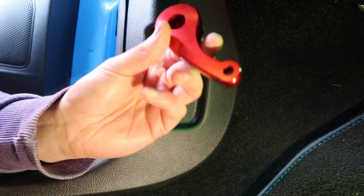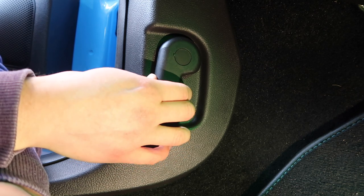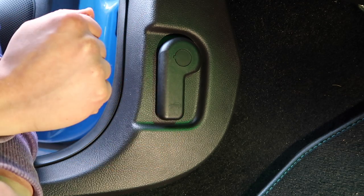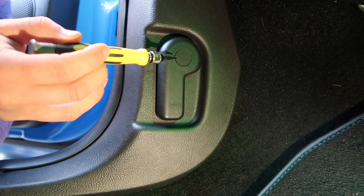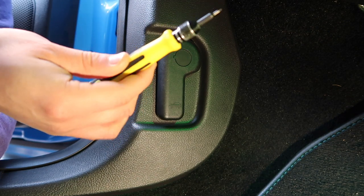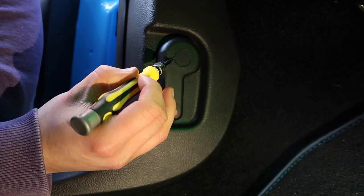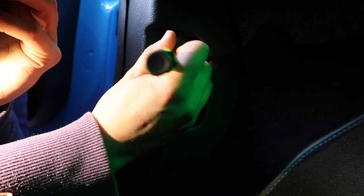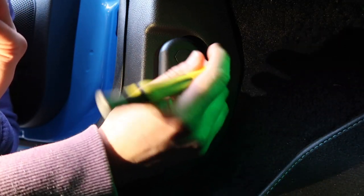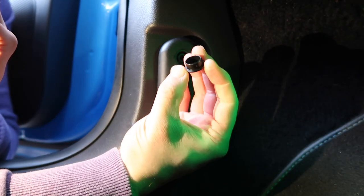We are in the car. Before we install the hood latch release, we have to remove the stock piece. It's fairly flimsy plastic, so it'll be really nice to replace. The first thing we need to do is remove this central cap. I have the smallest flathead screwdriver — I think it's 1.5 millimeters. There's a little flat flap on the outer edge of the cap. Just poke in there, and it raises up so you can get the cap all the way off. And there we go — cap removed.